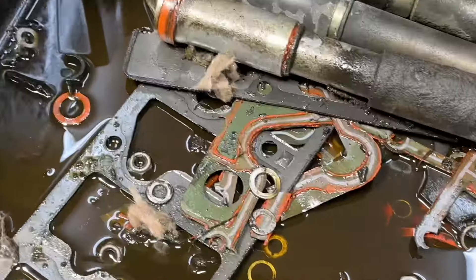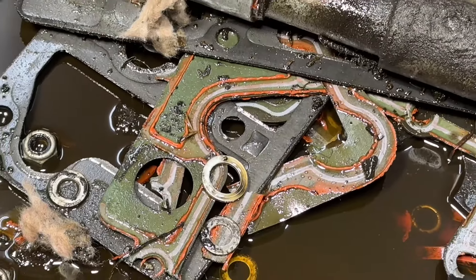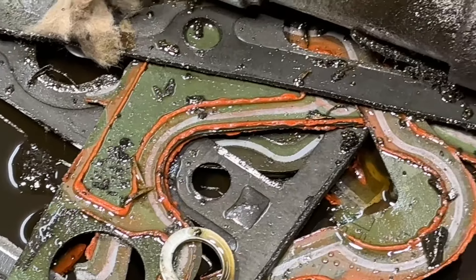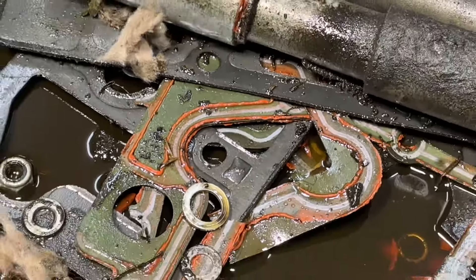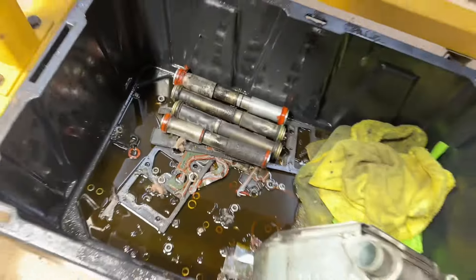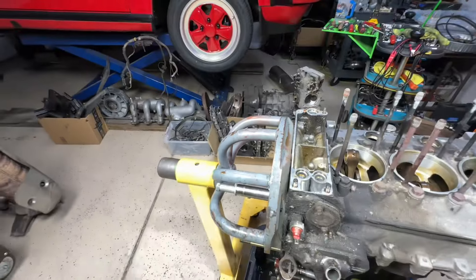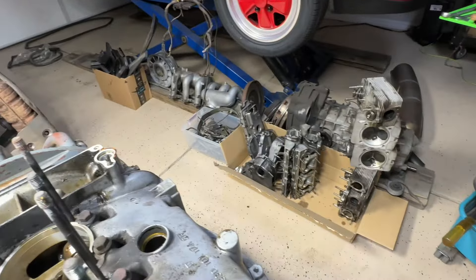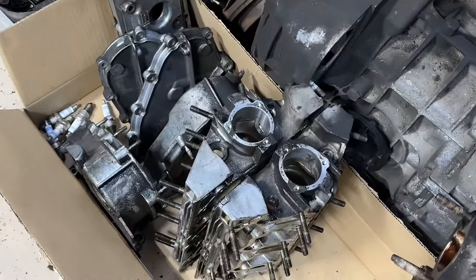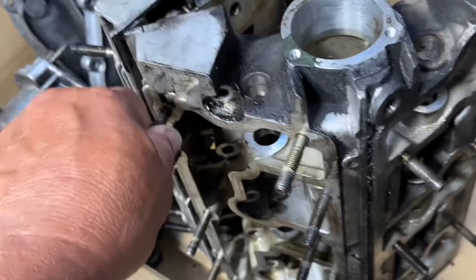And if you can believe it, they put silicone on the valve cover gaskets on the lowers, and you can see how it smooshed out and all that — so that's kind of scary stuff. The cam towers are going to go to Ollie's and they're going to completely disassemble them. They pull the tube out — I've seen Nadi do this. They pull that tube out of there that squirts on there because that's where the silicone will get in, and that's where the problem is from.